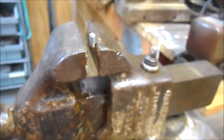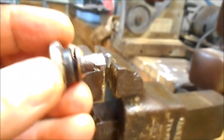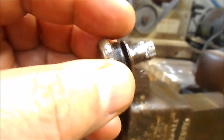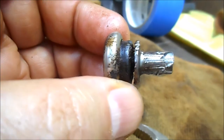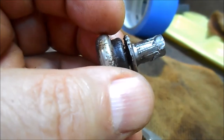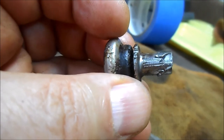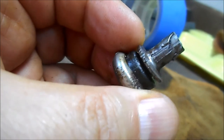Bad news for all you fans of originality - I got the third one out and was doing the same technique to try to get it loose, but this one was screwed all the way down so I couldn't get a grip on the bolt on the pad side of the insert. The bolt snapped right off - it had rusted and it snapped clean off. Now what we have is this assembly. If I could get this bolt out we could save it, but I have no way of steadying what's left of the threaded shaft with anything to try to spin this off, because the bolt is just pressed into this cap and it spins. I'm pretty well dead in the water here.